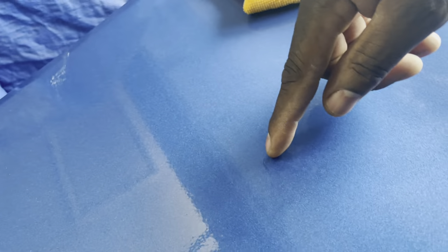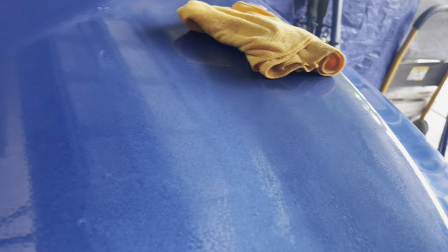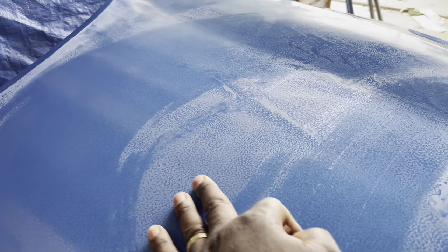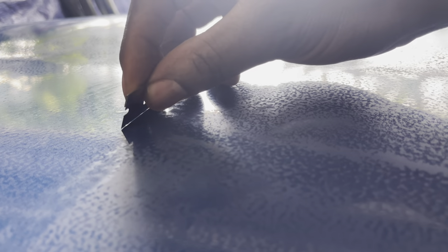If I wanted to, I could dig in a little deeper to level those areas. The buffing corrects the orange peel — you may see a little, but buffing digs in due to the sanding done prior. I can apply more pressure during buffing on those low areas, and the buffer will buff those surfaces too. If the orange peel is really bad, you'd apply more pressure so the buffer digs in to correct those areas.